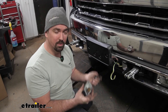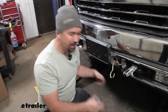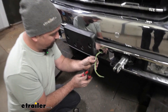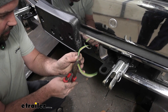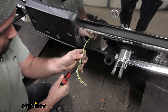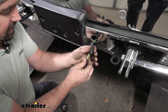Now we're at a point where we can get our six-pole mounted up. Again, if you have a charge line I would highly recommend having that here because it's going to go directly into our six-pole — it's really hard to go back and do that later. I have quite a bit of excess wire and I did that on purpose, but I'm going to trim a little bit. From here we're just going to separate the wires and strip them back a little bit. Before stripping them, take your boot and slide it over first to make things a little easier.